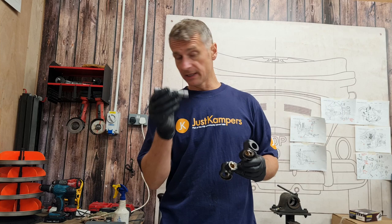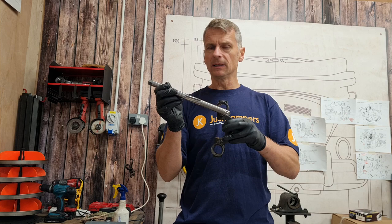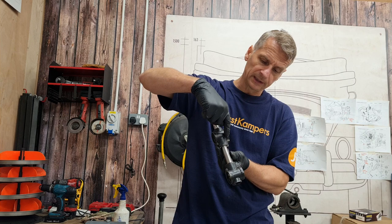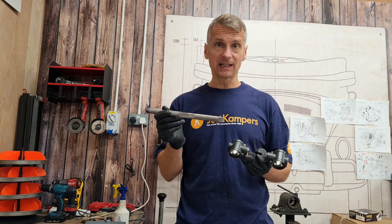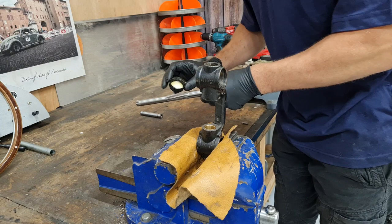We have our nice new bushes pressed in and I've cut the groove for the thrust washer cap. Our new king pin doesn't fit through the bushes yet because we need to ream them. We need to ream those bushes so they're in the same plane as each other — we can't just ream one and then the other, they need to be reamed together. We have a special reamer here, reamed to 18mm. If you don't have an 18mm reamer of this length — since you need to go through both bushes at the same time — you need to take it to your local engineering shop and get them to put an 18mm reamer through it, either on a machine or with a hand reamer like this.